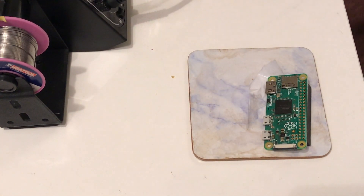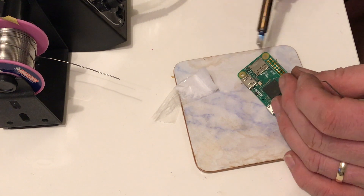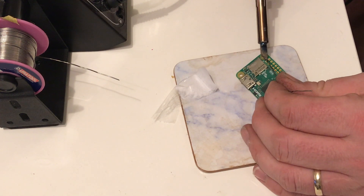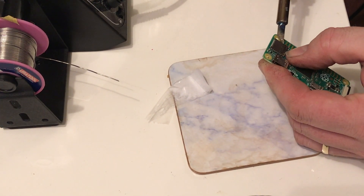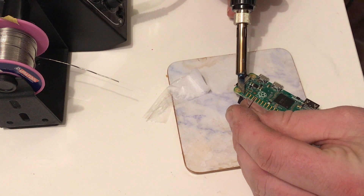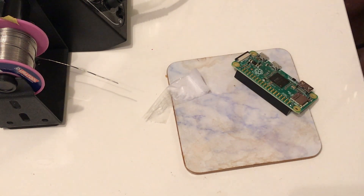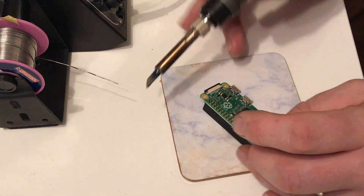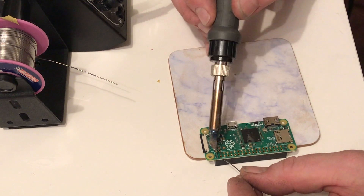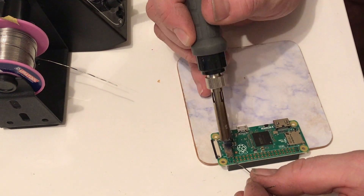What I thought I'd do is - I already had a Raspberry Pi and thought it'd be a good idea to solder it up and pop it into the Spectrum Next. I didn't have a header. I bought this and used it as a Commodore 64 emulator; it worked really well and booted up fast, but I didn't have a case for it. I thought it's a good bit of kit to get inside the ZX Spectrum Next - it allows me to load TZXs, SID files and various other things, none of which I could do as my spectrum is unaccelerated and didn't come with the Pi fitted. It's important that you put the header on the correct side, away from the logo or underneath the PCB, away from the micro card reader.